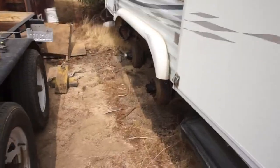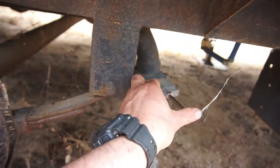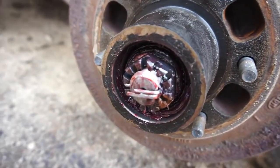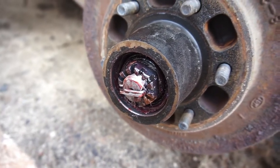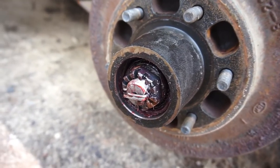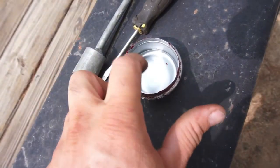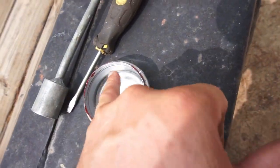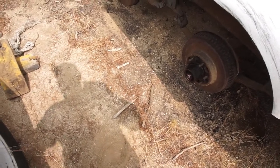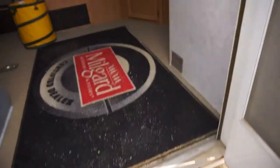Since I have the tires off, I can see I still have water in here — that's fresh water, or old fresh water anyway. I decided to take these off. The grease smells really good, doesn't smell cooked or burnt. The drums have no play, so since they're clean in here I'm gonna take the caps off and pack some grease in — fill it up about halfway — and throw the caps back on.